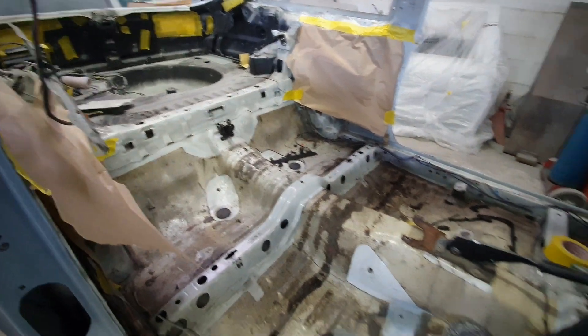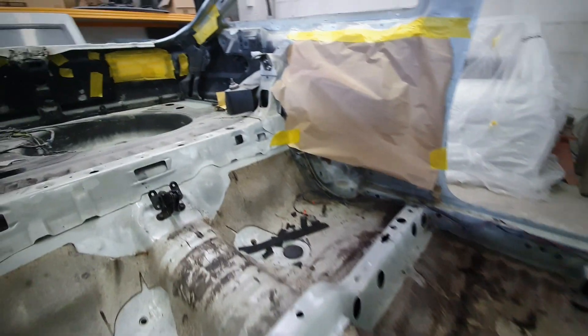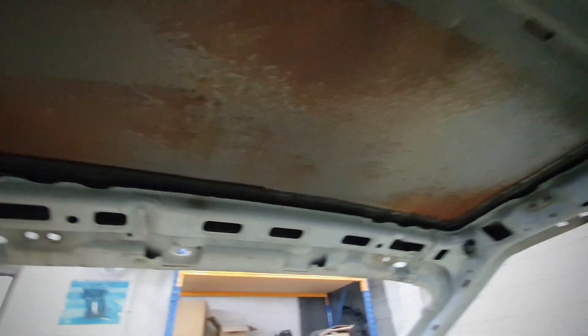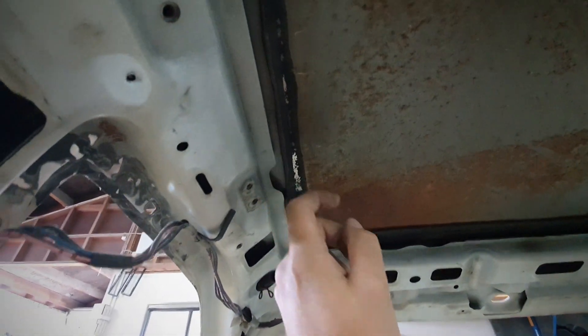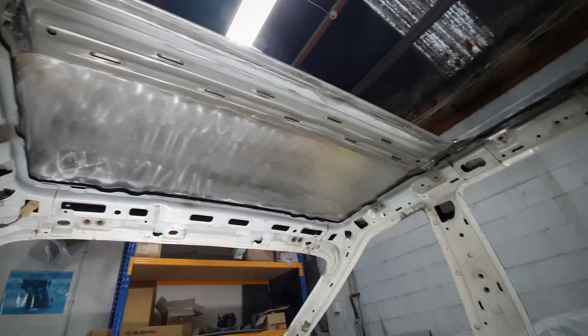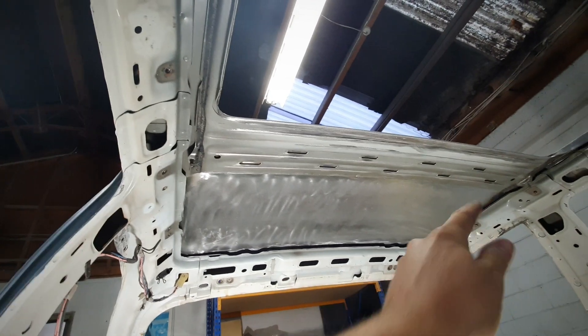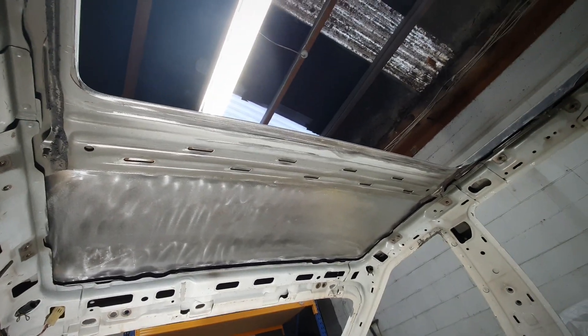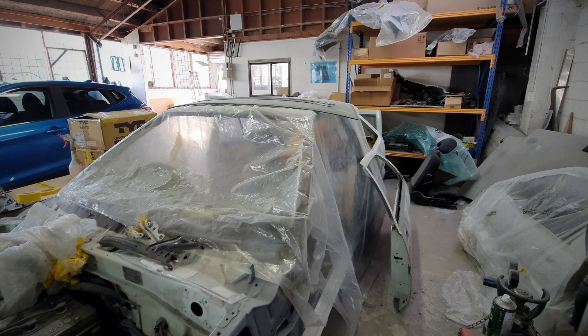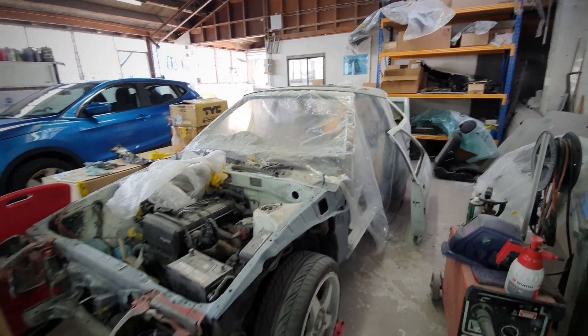Just had a bit of a quick vacuum in here — sucked all the crap that was laying around and pulled everything out. I've just been scraping away all the sealer that's up and around there. Close up you can see the rust in there — going to clean all that back tonight and rust neutralize it. Just cleaned this back to metal the best I could, and now it's going to get some rust neutralizer. Cleaning this lip back too, so there's a nice fresh start along that piece so nothing creeps around the corner. Nice and covered up now — it's been raining so just trying to keep the moisture out. This is where I'm going to leave this video off. Thanks for watching and I'll see you in the next video.